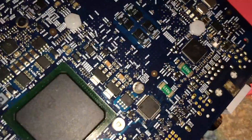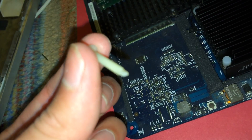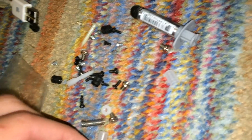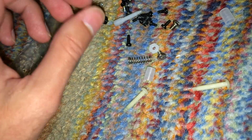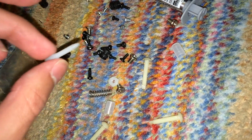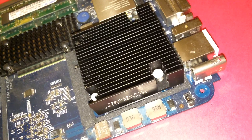You can see the screws have a flat-head bit on top and a white plastic nut on the bottom, and they also use the springs from the original mounts. I did get the original mounts with this machine — they're right here — but the clip part that goes through the motherboard is actually broken, so these are pretty much junk. The springs for the G4 mounts are also shorter and not as stiff. I'm going to go ahead and remove the CPU heatsink, then resume the video once that's done.